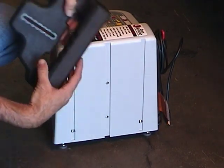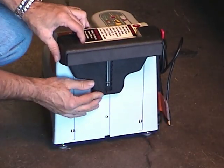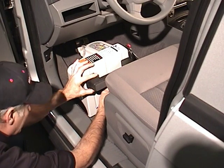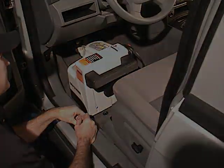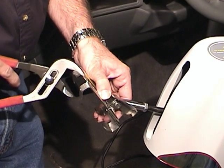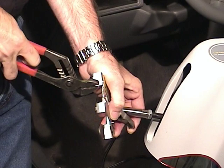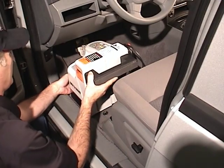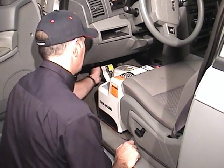There are two anchor holes that the knob on the seat pad may be threaded into for additional fit options. Also, the seat pad may be rotated 180 degrees or removed entirely for a better fit. Adjust the seat pad up or down until it's level to the bracing point you have chosen. Press the air relief button. Extend the arm with the clamp on it and connect the clamp to the brake pedal. If necessary, use pliers to bend any or all of the tabs to better fit the vehicle's brake pedal. There is another tab at the top of the clamp which may also be bent for a better fit on the brake pedal. Next, move Evenbrake forward until the cylinder is retracted back in the box. Move the seat forward until it contacts the adjustable seat pad. Make certain the brake pedal is not being depressed by Evenbrake's pedal clamp.